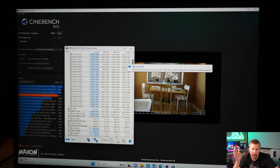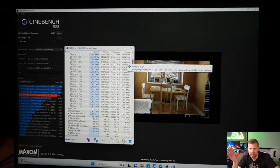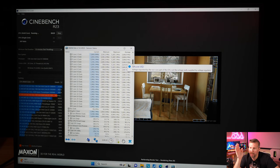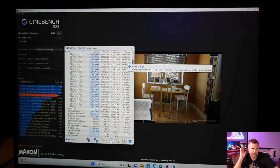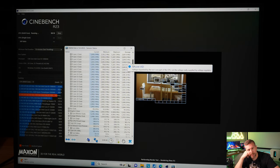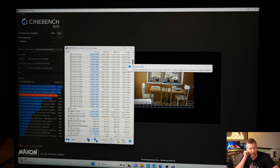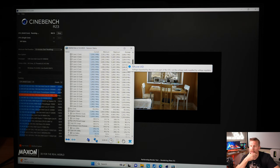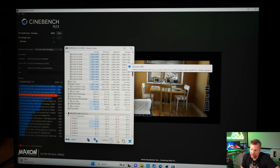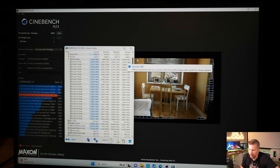It's just interesting because a lot of the Intel laptops, like the really well cooled GT77, man, we're pushing really high wattage through that CPU sometimes, like 80 or 90 watts, with the GPU pulling 150 watts or something. And the temps oftentimes were still so good. It was still like 75 degrees on the CPU. Like, what? And the GPU was like 65 degrees. It was like, holy crap. So in terms of total thermal headroom and load, I would say the GT77 still is the best, just because of its crazy four-fan thermal cooling design.